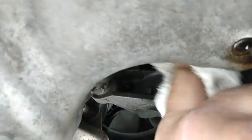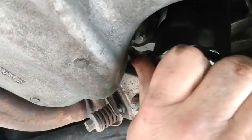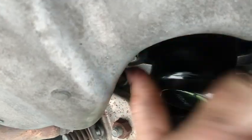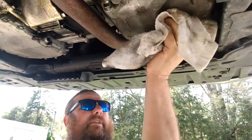Make sure you're not going to double-gasket the oil filter, and make sure it's all clean and the old o-ring is gone. Lots of people have done it — it looks like it's a spot that's supposed to take the seal, but now it's another seal and the oil will spray out. Wipe off your area so you can tell if it's leaking after you finish your job.